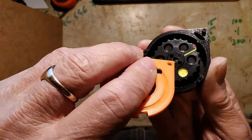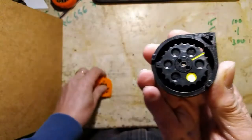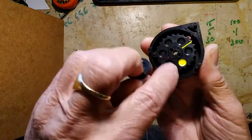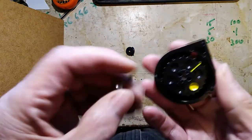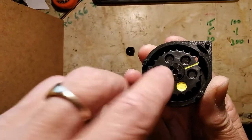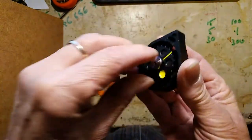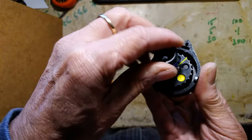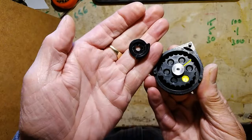Now if you over tighten it, then that boss on the silver screw will dig into this area here and will then cause the black part, this here, to actually be forced down and to bind onto there. So that's the major problem which I think you may have, is that perhaps you've over tightened it, and because of that, this part here, when it goes in too far, actually ends up clamping this part, which means that as you then rotate this part to take the cover off, in fact what you're doing is you're rotating this screw part instead of just this part.